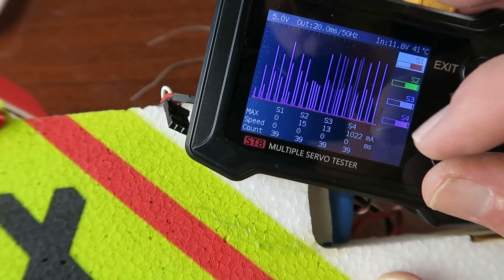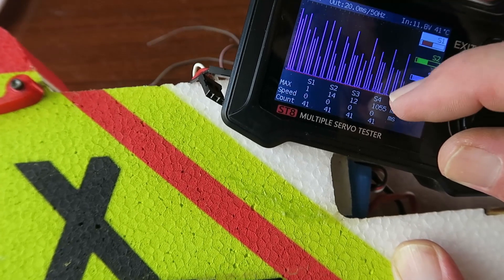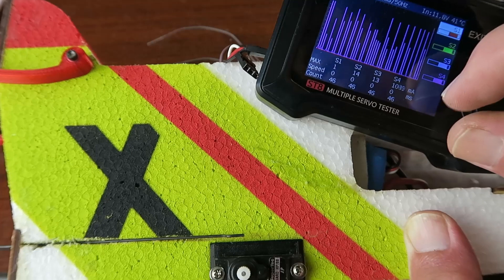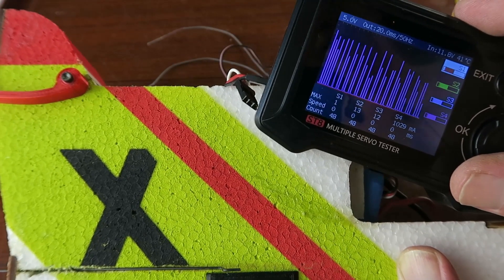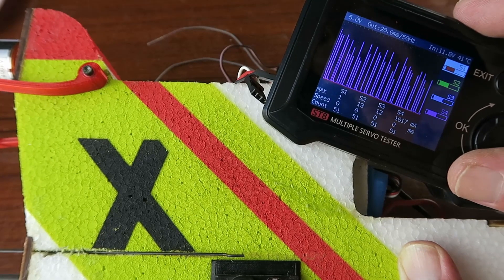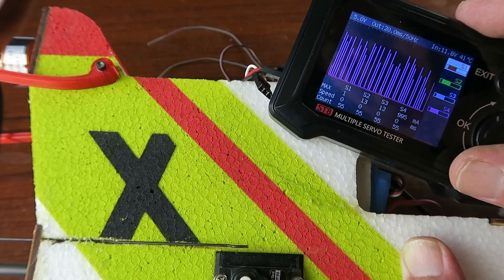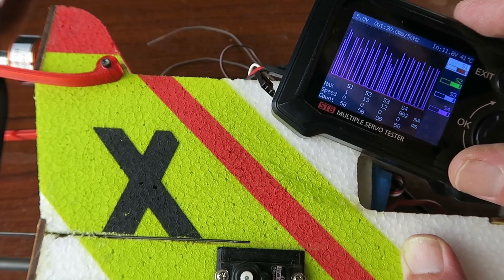When we add up the numbers, there were 3 times 600 milliamps plus this one. If that was running at 600, then that would be over 2 amps, and the BEC on the ESC is only 2 amps. What I will say is that if all 4 control surfaces were moving in this fashion, the aircraft would be flying in a very strange mode indeed, so it's not a real-life test. But you can see how close to the 2 amp limit in some circumstances that will be getting.